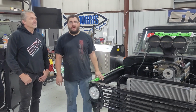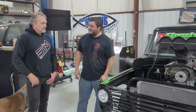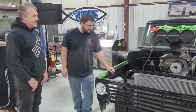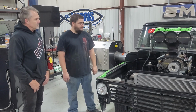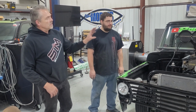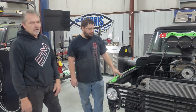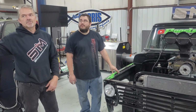We're here, so as you see, we had the computer issues. Steve can kind of explain a little bit of it, I guess. Maybe. I don't know. Do we really know what's going on? Lots of noise. Shuts the computer off. Lots of noise. So we're just trying to, and it seems to be grounded, right? Everything seems good there. Typically, you can replace the spark plug wires. That makes a lot of noise. It is a little more common to have issues with 7ALs with a typical old school MSD system. They are noisier, but there's got to be a way we can figure it out on the computer here. It just shouldn't shut off like that. I don't have the problems on my engine dyno like that.